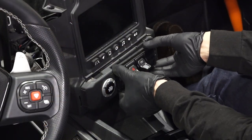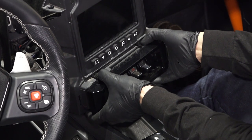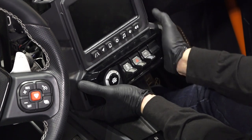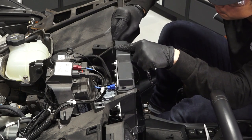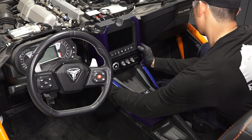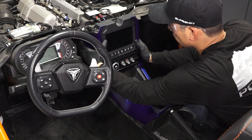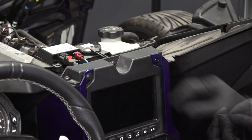For vehicle reassembly, begin by reinstalling the switch panel and console trim. First, put the switch retainer bezel and switch bezel in place. Next, put the display center in place and install the retained fasteners. Then put the center console trim in place. Next, install the two retained push pins from the center console trim.